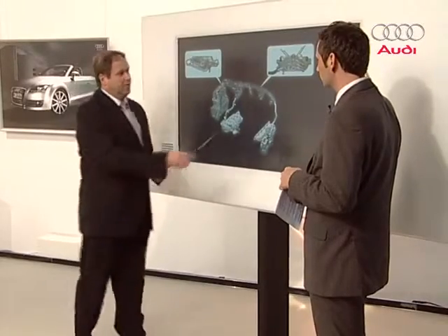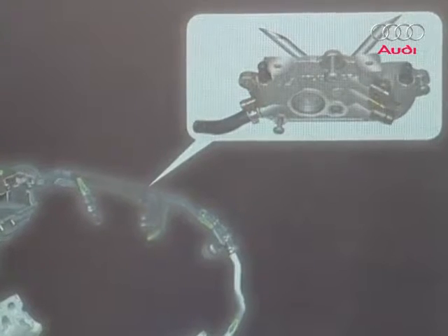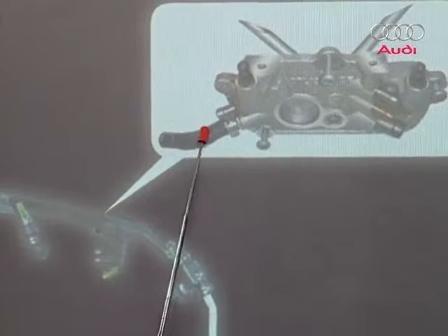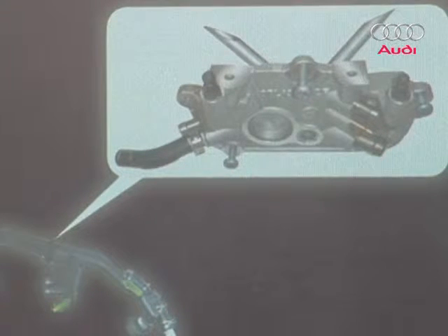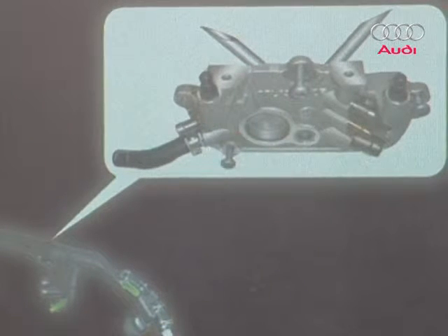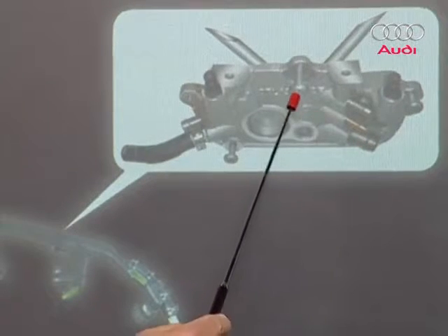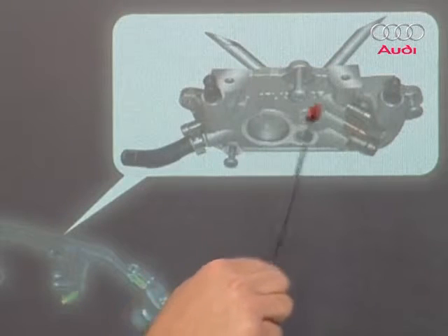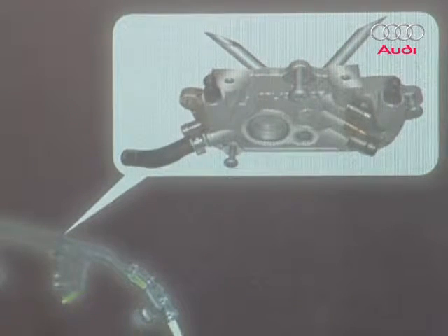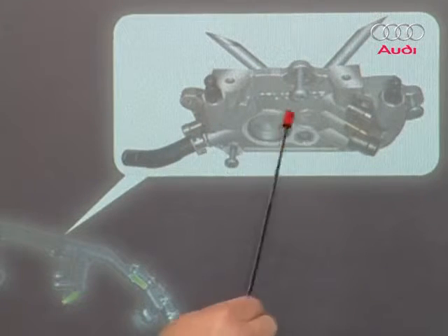Is there anything special about this engine's intake manifold? Yes — if you look at the smaller image you can see lots of connections. Three of them are coolant connections — these two and this brass-colored one are coolant connection pipes from the cylinder head. Coolant flows through here, and this is what we call the heating of the crankcase breather. The blow-by gases come from the large connection and are split internally between the two pipes, distributing gases to each cylinder bank equally. The gases have a very high flow rate and we add extra heat here so that the crankcase doesn't ice over, using the engine cooling system to heat this central area.